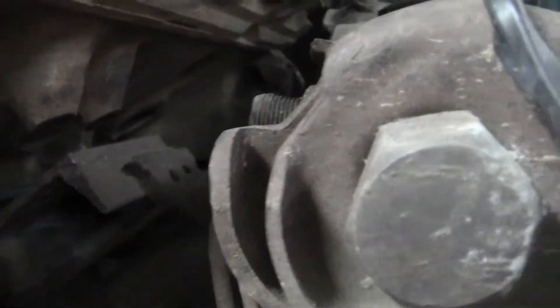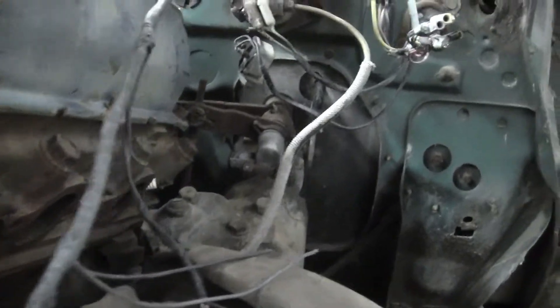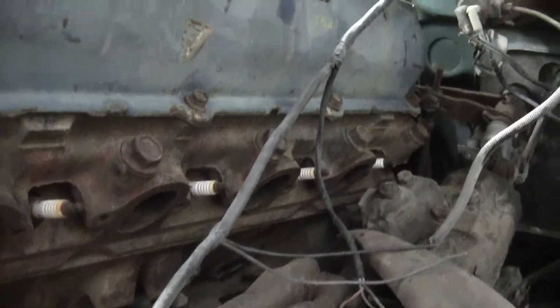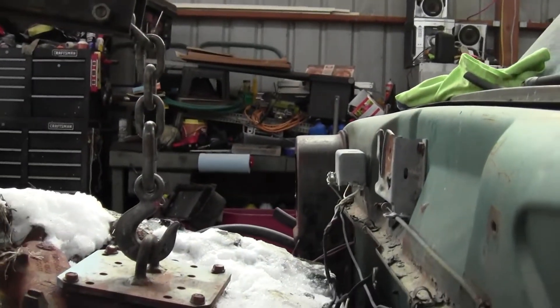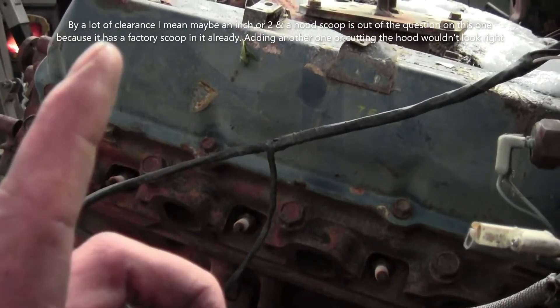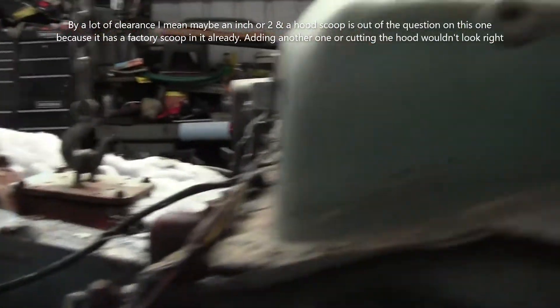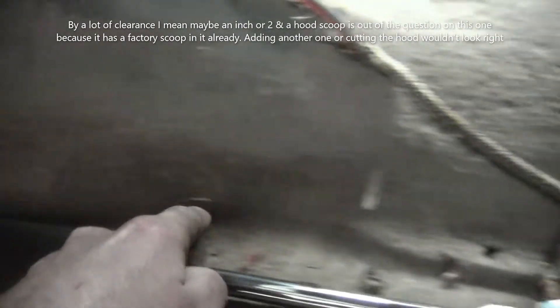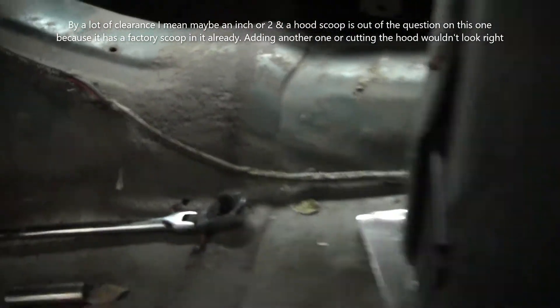That's the mount I'm going to use because it's nice and tight and I can get it down in there. You can see how much room I'm going to not have, especially around that steering box — that's got me a little bit worried. I've got a lot of hood clearance there, and if I have to I can bring this whole thing up by cutting out that tunnel hole and raising the hump. That's dangerous territory for time — I've done it a million times. You can kind of see it done on that '39, we moved that one way up.